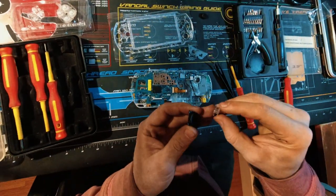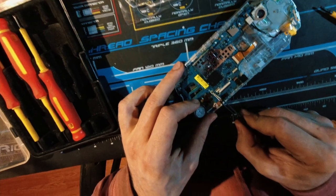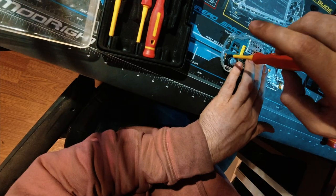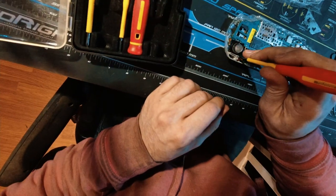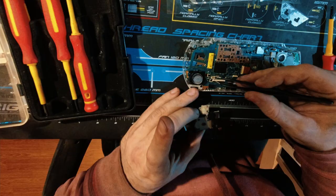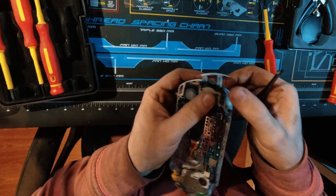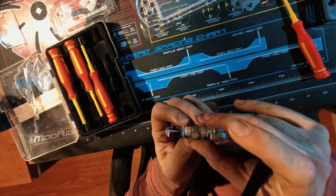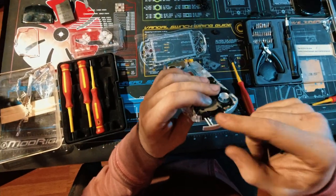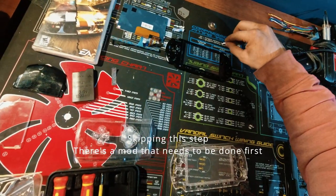Now I believe it is time for the joystick. I can pop the black one off and I'm going to put the clear one on. Now we can just take the connector and put it in here — close it, and now this just slides in. Now the screw for the thumbstick. I can also put the screw in for this trim. This ribbon cable just gets pushed down — make sure that goes into the channel. Make sure that those both go on the outside and don't actually go on the port by mistake. The memory stick can go back in now, and that will hold it attached to the logic board.